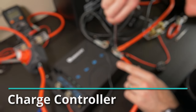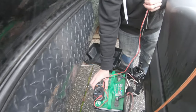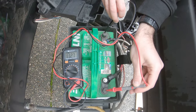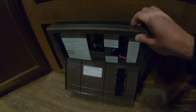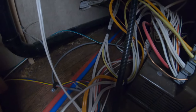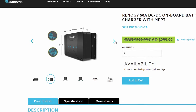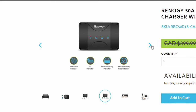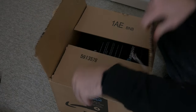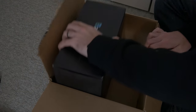The second component you may need is a charge controller that supports a lithium battery charge profile. Different batteries need to be charged differently, and although you can theoretically drop in a lithium battery on an old controller, that won't let you use its full capacity. Our 2016 converter did not support lithium, so we opted for a separate charge controller to tie in shore, solar, and alternator charging with one device — a Renogy 50-amp DC-to-DC battery charger with built-in MPPT solar charging.